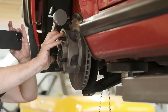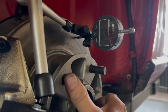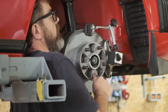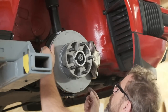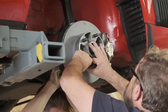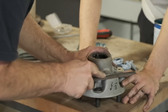The run-out was now within one hundredth of a millimeter, which — I admit — is a bit insane. But I told you before that this is a maniac channel. At the right side things were good as well. We started with six hundredths, and in the process of optimizing it came down to four. We first tried combining certain positions of the wheel carrier with certain positions of the disc, hoping that their tolerances would annihilate each other — which they didn't. Eventually we very carefully took off some material from the wheel carrier with a file, and managed to improve the right side to almost the level of the left one.